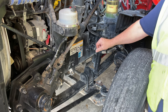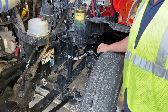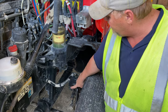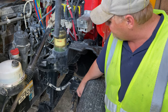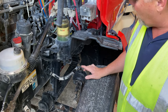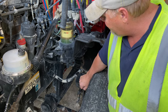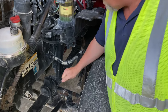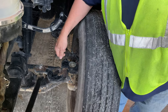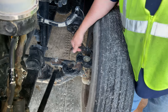My brake airline is not cut, bulged, or lacerated, and is properly secured to my brake chamber. My brake chamber is not bent, broke, or leaking, and is properly secured with all their nuts — no rust trails or shiny spots to indicate looseness. My slack adjuster and rod are not bent or broken, are properly greased, secured with a pin and cotter key, and have no more than an inch of slack. My brake drum is not blued from excessive heat, not bent, cracked, or ovaled. My brake pad is above a quarter inch of thickness, with no grease or oil slung to indicate a leak or prevent me from stopping.